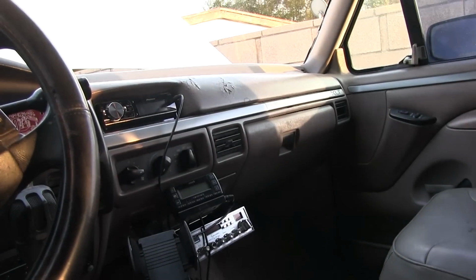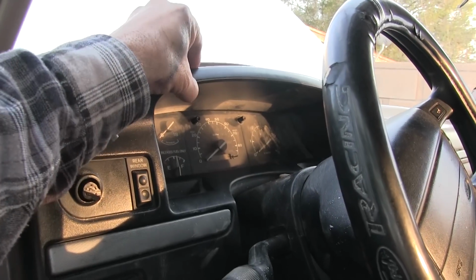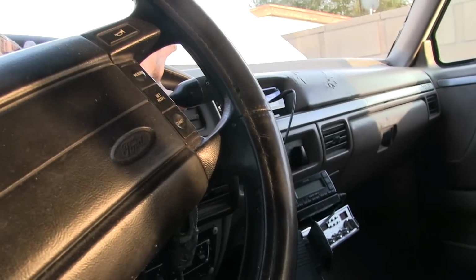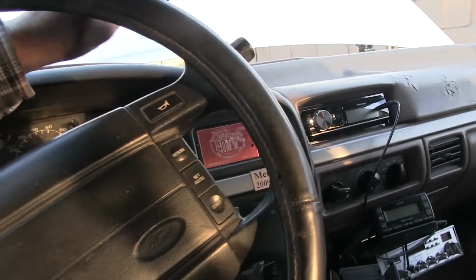The dash. What do you do about the dash over there? Well, that's another thing. I gotta see what's up with this dash. It's messed up right now. My buttons don't work on the electronic shift control. You can't see it from there, but on the transfer case. I don't know what's up with that. Could be a fuse, could be just it got unplugged or something. That'll be tomorrow, maybe. I think I got most of everything taken care of here.